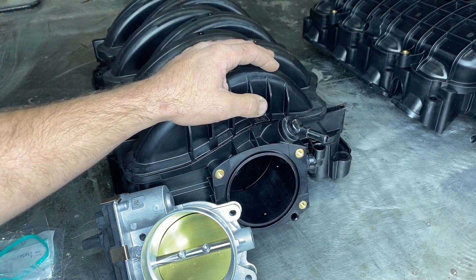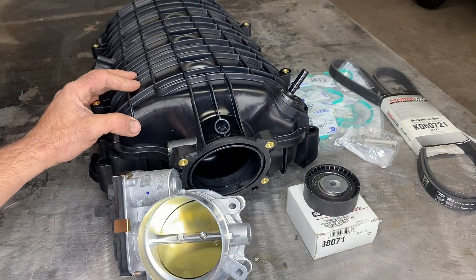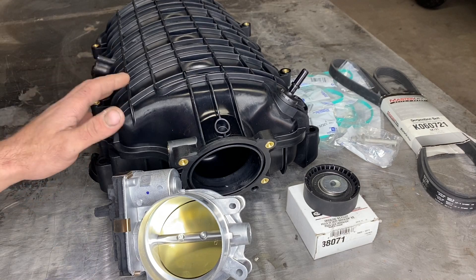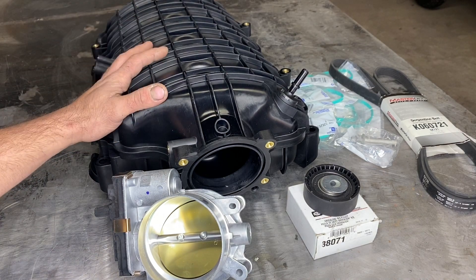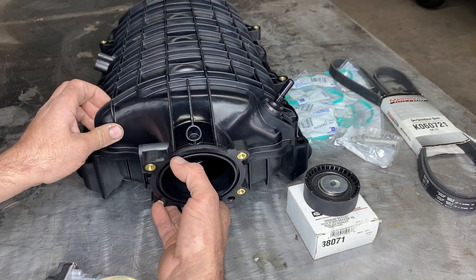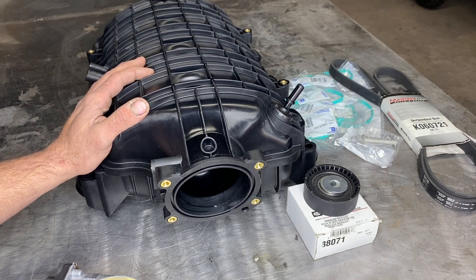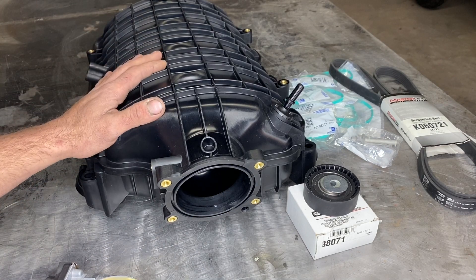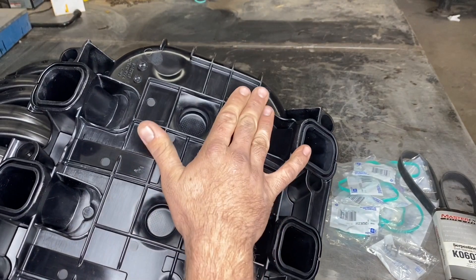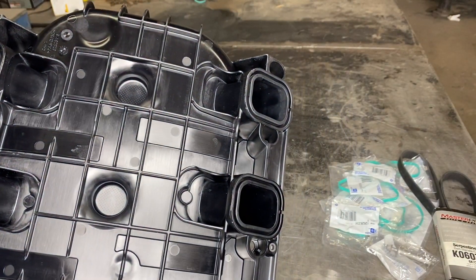Now on to the LT2. The reason I'm choosing the LT2 intake over the LT1 is because it has a much larger plenum design and longer, equal-length runners. The LT1 is definitely a great intake manifold upgrade for trucks, but the LT2 is far superior. If you look inside the plenum, it is huge - definitely a lot taller and lengthier than the LT1. The install is a little more involved. As far as bolting it down to the engine, the first thing you'll have to do is get rid of the ribs on the back side of the plenum - you'll need to take a Dremel and shave them down. All those little ridges on the back half will have to go.